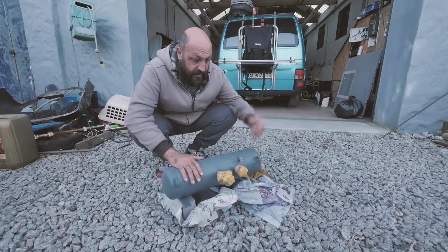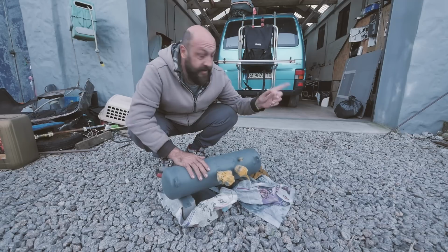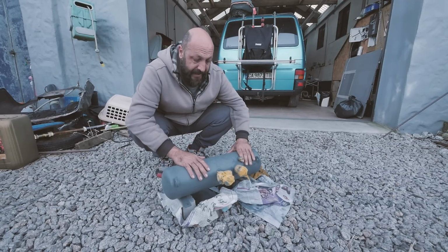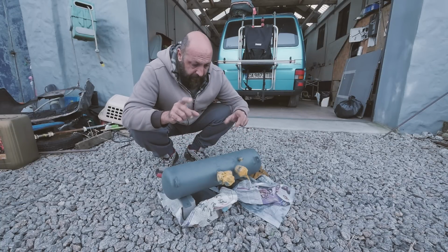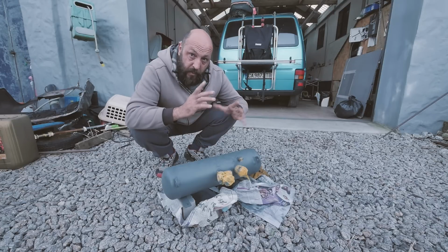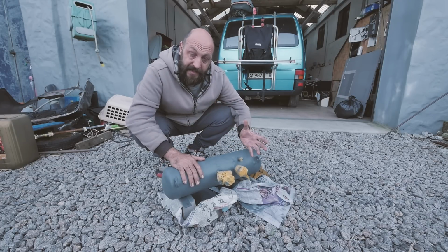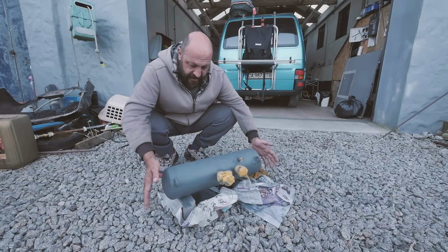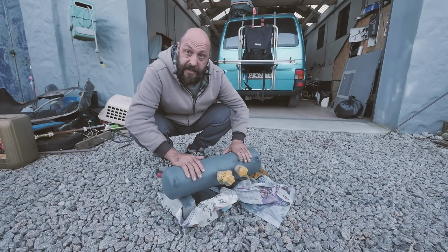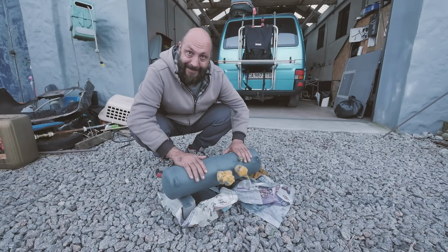Today what I'm gonna do, I wanna take down all the parts, grind them, and put some zinc, some Stone Guard black and some black paint, and then put everything back. I will also make sure that I put some primer on the parts of the body where I make holes to fit, because I don't want any rust to get there. So now this is ready with the first zinc, and we can do the Stone Guard. Let's do it.